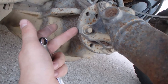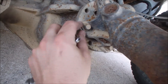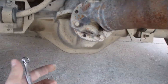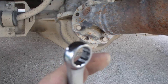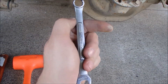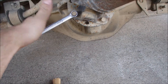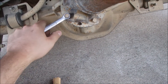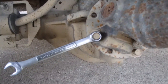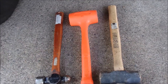You can also heat it up, just this back part, heat up that back part and then try and crack these loose. That'll help. Basically what you want to do is get a 12-point wrench that you don't really care about. This happens to be a 12mm. The reason I say get a wrench you don't care about or is cheap to replace is that you're going to hit this with one of the hammers in your selection of big heavy hammers.